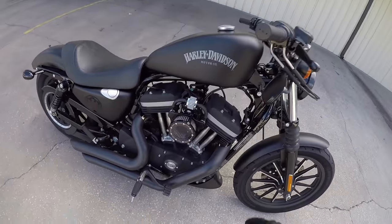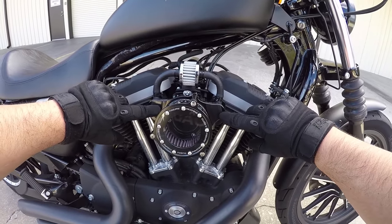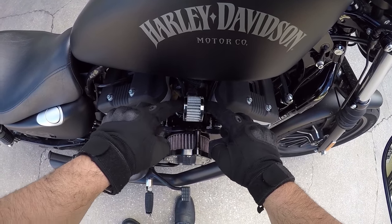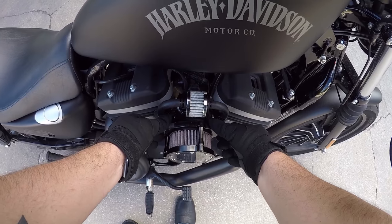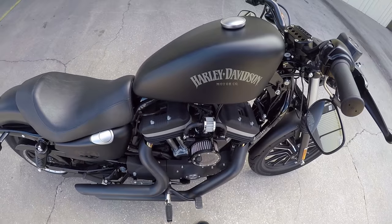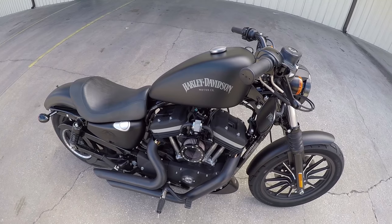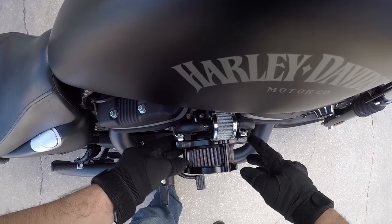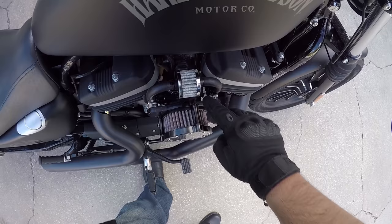Normally I had those two bolts in there beforehand, but unfortunately with the new breather bolts going into these hoses, they didn't have room. So I've currently sealed that with some silicone self-adhesive tape, and I'm gonna find two smaller bolts, nuts, and washers to kind of go over that. But there's really not a ton of room in there. We'll see how that holds up — definitely not a permanent solution though.